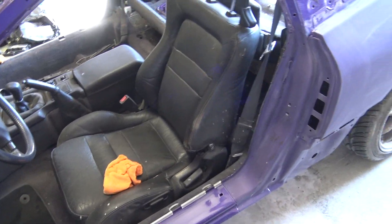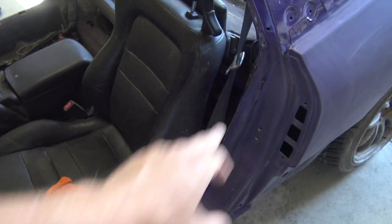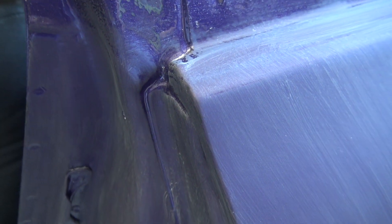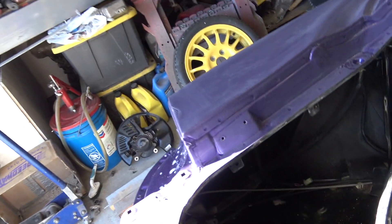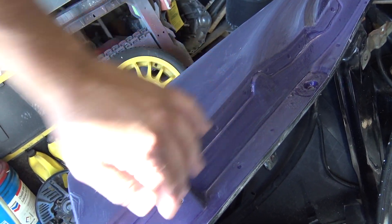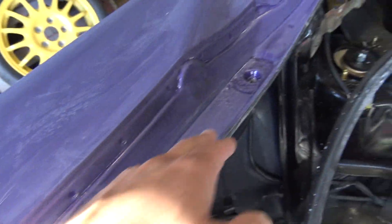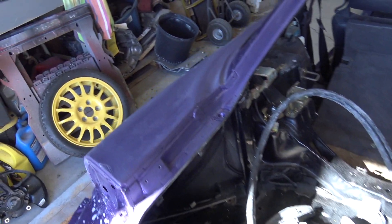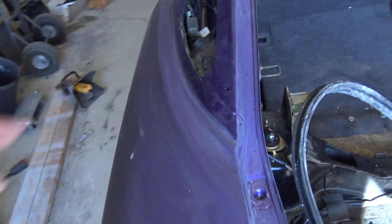Last night I pretty much got everything scuffed. The quarter panels are done on this side, and that part of the door as well. You can still see it's a little bit shiny — I need to get some scuff material and emery cloth and scuff that. Up here was where it was a little bit dry. You can still see a little bit of orange peel that I need to sand out so it's smooth, and in the cracks I'll use scuff material to get it to a point where I can put a new coat on.